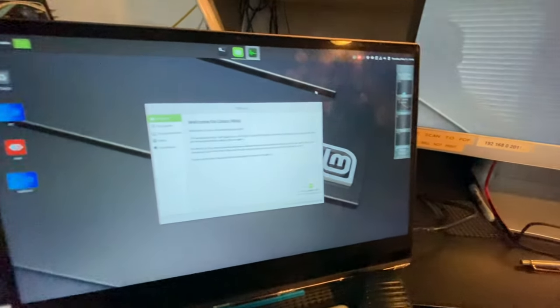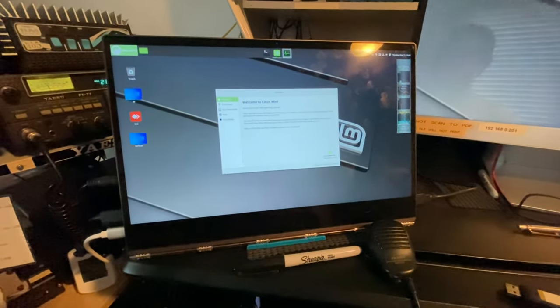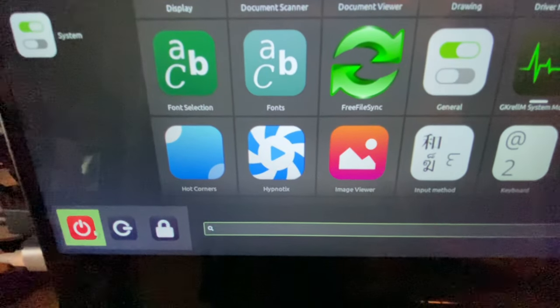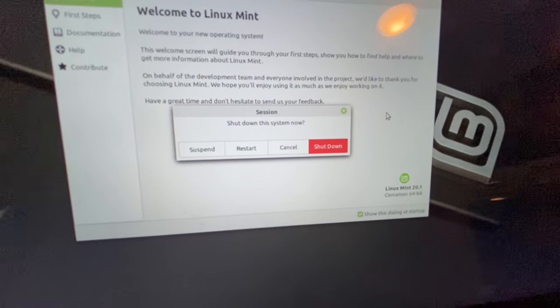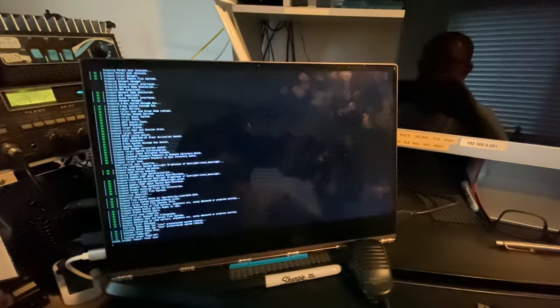First thing I'm going to do is just unplug one of the external hard drives I've got here. It's the one that I call Hotel. What I'll do is I'll shut the machine down and unplug that one. But that USB port is where I'll put the Clonezilla USB sticky. All right, so let's shut down this Mint and shut it down. And I love looking at system messages. That's shut down now, so I'll just pull this one out, okay?